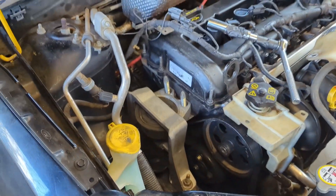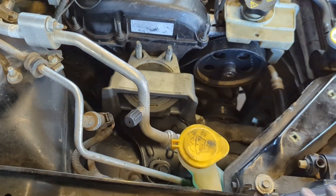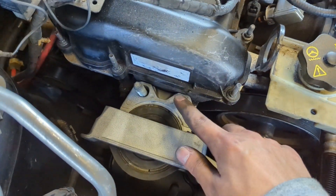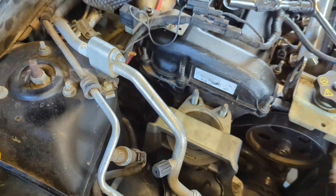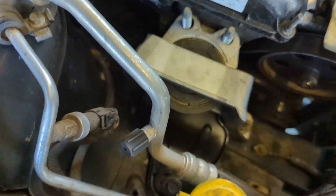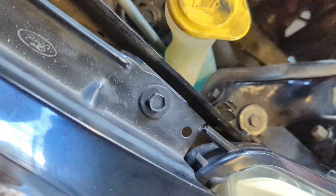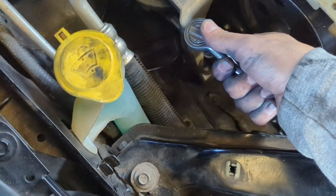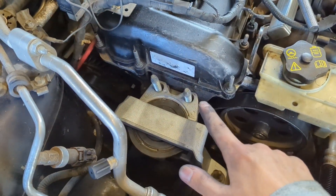Before we button everything up, a couple of important things. First, you need to get every single bolt and stud just barely started, because you're going to have a hard time — especially with the studs — getting everything lined up. You may have to push and pull on the mount and even on the engine a little bit to get everything situated. Once you do that, you'll have all the bolts seated and ready. Just go ahead and hand-tighten everything as tight as you can. The great thing about not using an impact tool is that with an impact you can get it too tight or not tight enough, but with a hand tool you can get it really hand-tight, and that's more than good enough.